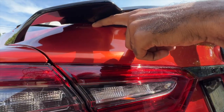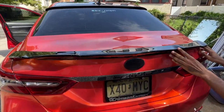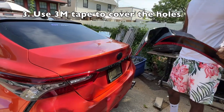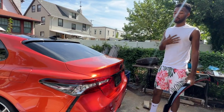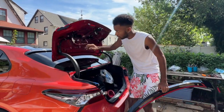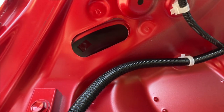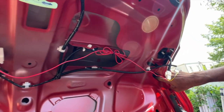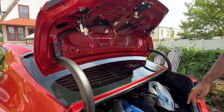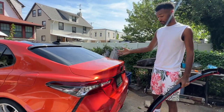The big ones right there are kind of exposed — you can't see it but it's right there, it's half slit. Same for the other side — the hole over here is exposed. The third option is if you get some 3M tape. Now this is going to look kind of cheap and tacky, but you may not see it or may not care. If you've got OCD like me, you're not going to do it. Place the 3M tape right here inside this hole to cover it, and you won't have any water issues. This 3M tape has been on my car for about two years and I've never had any water issues.